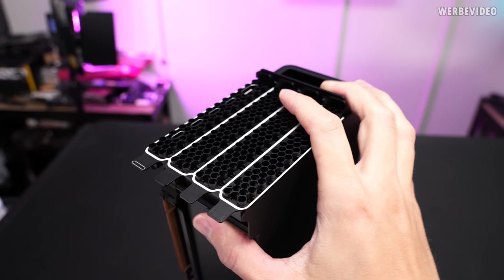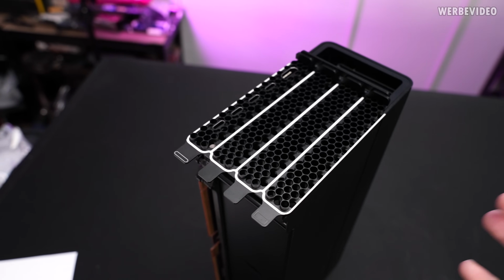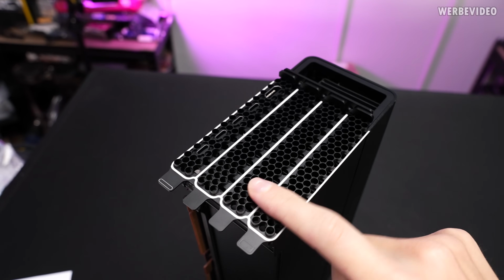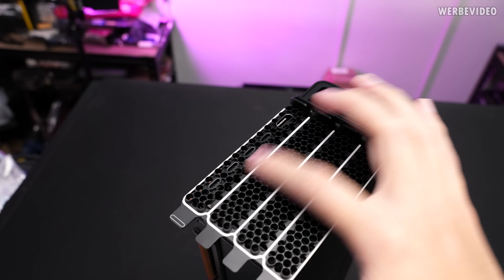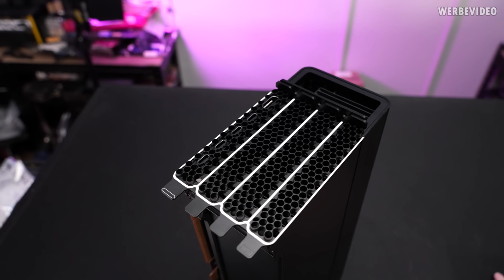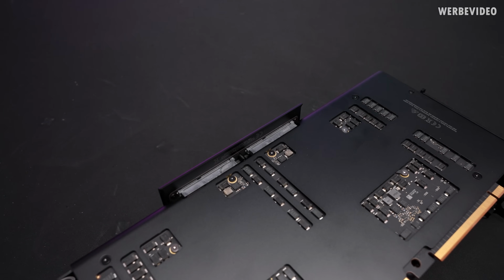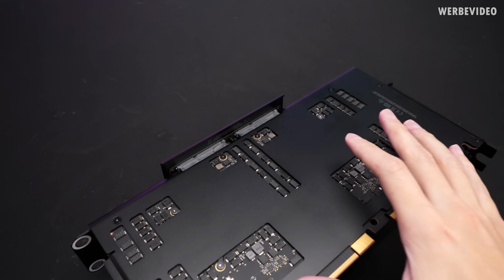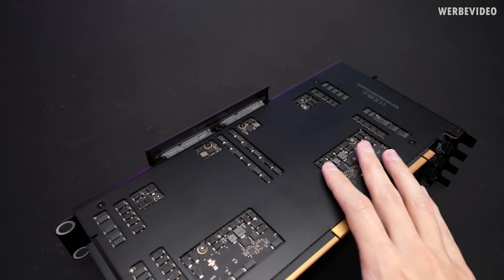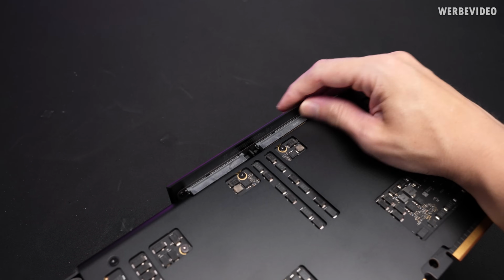If we look at the front, also this part is absolutely beautiful. We have a lot of aluminum. It's probably milled aluminum. The front I/O part looks really good. We have one HDMI, and those should probably be the Thunderbolt connectors for display connection. There's one more connector on top of the card, which I think is probably just normal CrossFire, because you can theoretically hook up 2 of these cards. So you can run quad GPU. But I'll just try to remove this cover.